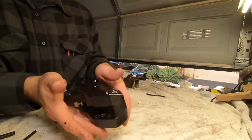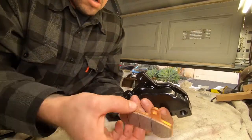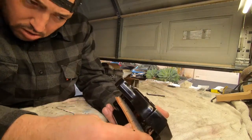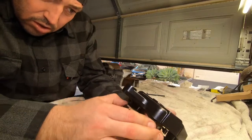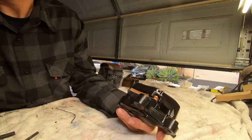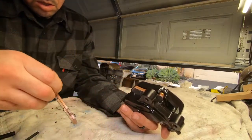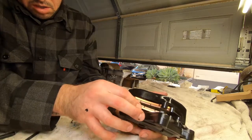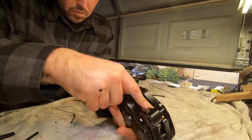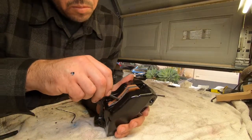With a little bit of video help from YouTube, you can save yourself a lot of trouble. Anyway, what we got here is brake pads — I'm putting them in. It's not something I do every day, so I'm looking at every single little piece that I'm putting in. I'm greasing up the backs of the pads, doing the best that I can to make it a really good, flawless setup. Making sure everything fits.